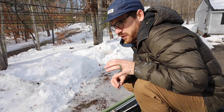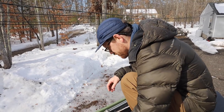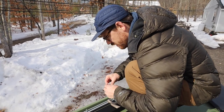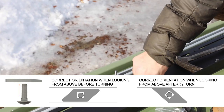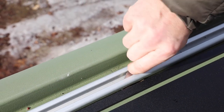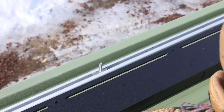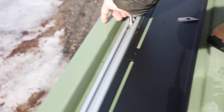With all things van, nothing is as easy as you think it should be, even with a kit. Our roof rails they say were factory roof rails but maybe they're not. This little piece needs to slide into the roof rails to attach the side rails, but there are little bolts that attach the roof rail to the van itself, and that's blocking the slide path. So what I've been doing is just using another carriage bolt and giving it a little tap tap tap to knock it over.